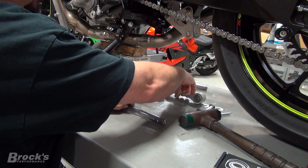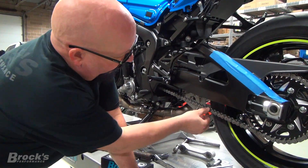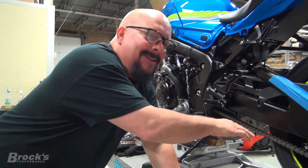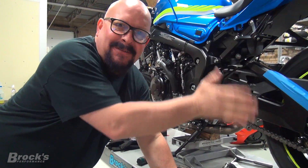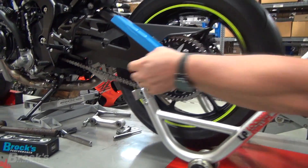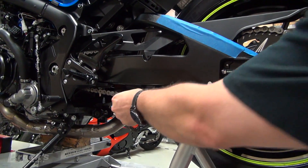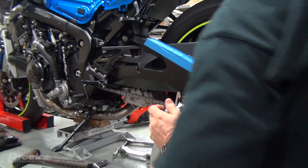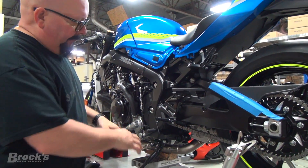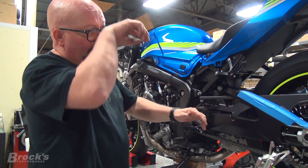Make sure you put the parts back in the same way that they came out. You can see there's no shim washers here but there is a spacer, an inner bearing race that goes in in a particular orientation. Now at this point we can start talking about chain tension. We have this chain tighter than most guys would run. If you are on a dirt bike, don't run it that tight. Let me just demonstrate - here's the amount of tension we have, equivalent to lowering the bike - much, much tighter. When we're all finished, you're going to have to readjust your chain tension to match what we're doing.